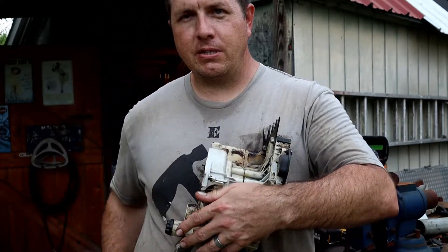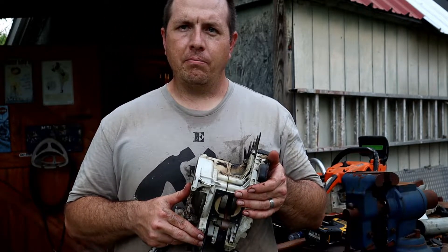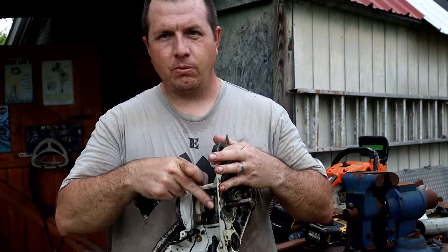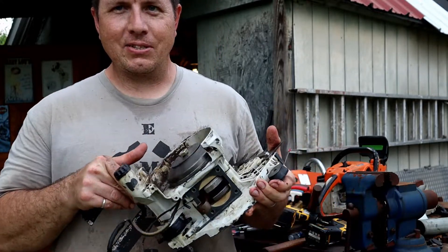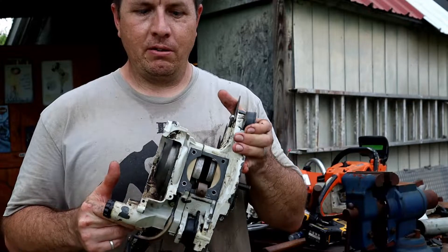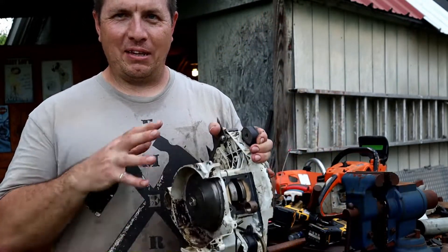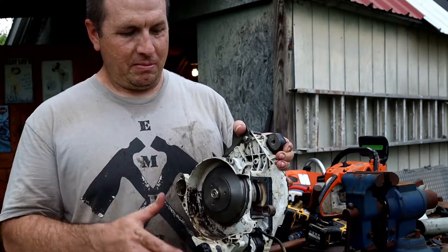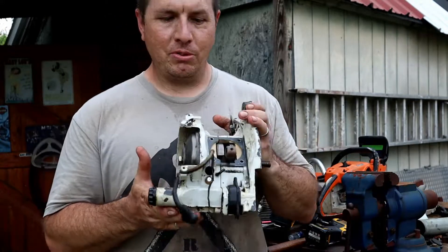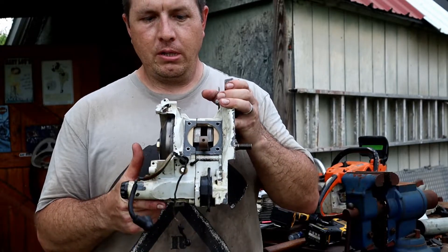In part two I'll have the replacement jug. We'll put it on the timing wheel and get some timing numbers. The exhaust port looks pretty anemic — I'm going to do the layout fluid on the piston, draw the edges of the ports onto the piston, and make some decisions from there. I definitely want to port this. For that much piston size and duration, I'm hoping to get a lot more out of it. This one is definitely going to get ported. I want it to be the best running 056 AV and still look like a piece of junk — not touching the paint or cosmetics.